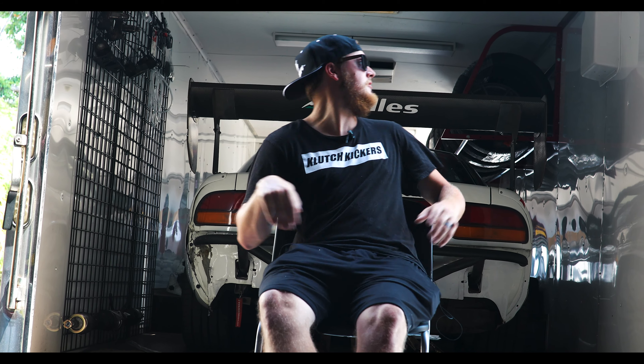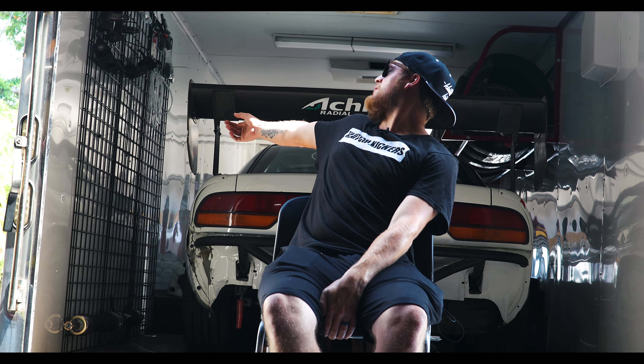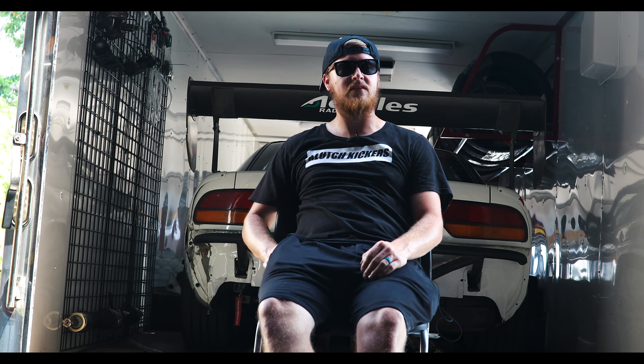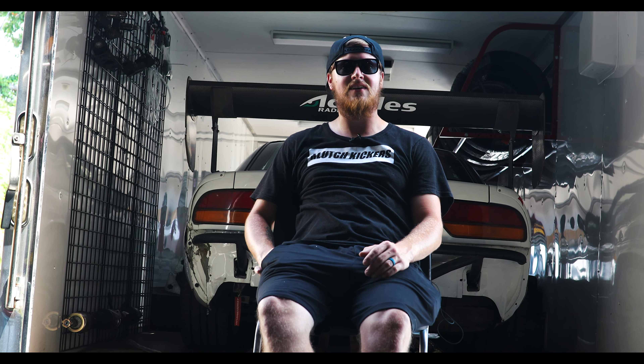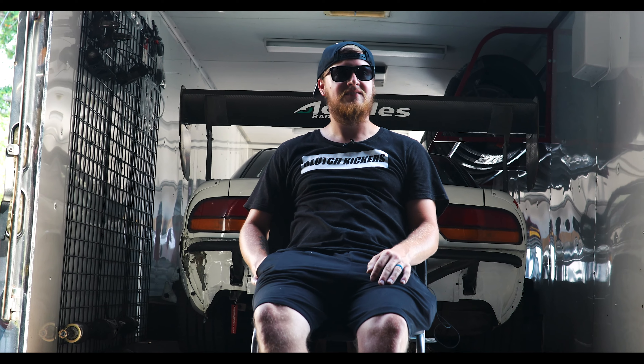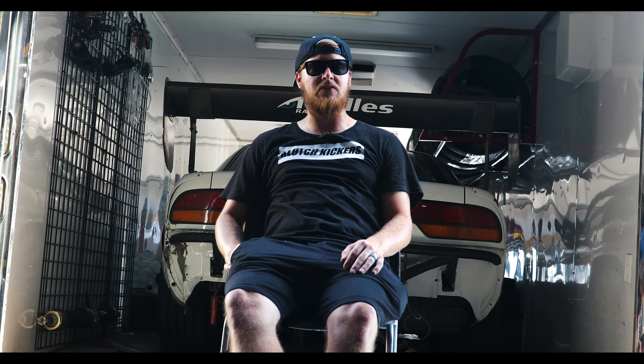How about the trailer? Did y'all do any modifications for the trailer to get ready for the tour? Yeah, the trailer has new wheel bearings and they've been greased all the way around, checked the brakes on it, made sure all the batteries were good to run the electronics in the trailer. We added some tire racks up there to get more room in the trailer, and then we added some spare parts racks so we can keep all the spare parts out of the cabinet and take more stuff with us. Hopefully Nick has everything he needs to get it fixed at the track.